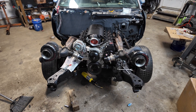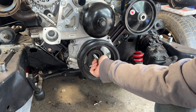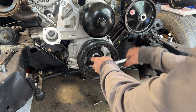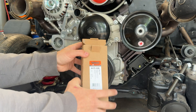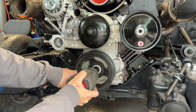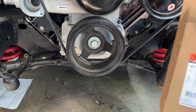Let's check with the tubular radiator core support what it's looking like now. Before installing the belt, I need to install the harmonic balancer. I picked up a harmonic balancer installer for about 20 bucks from ICT Billet — really smooth piece and it made this install way easier. ICT Billet was actually one of the most affordable options out there. With the harmonic balancer installed, we're ready to put the harmonic balancer bolt on, which we got from Dorman Products. It's got thread locker on the back, which is awesome. Make sure you torque this down twice — first to 37 foot-pounds, and the second pass, 140 degrees of additional rotation.